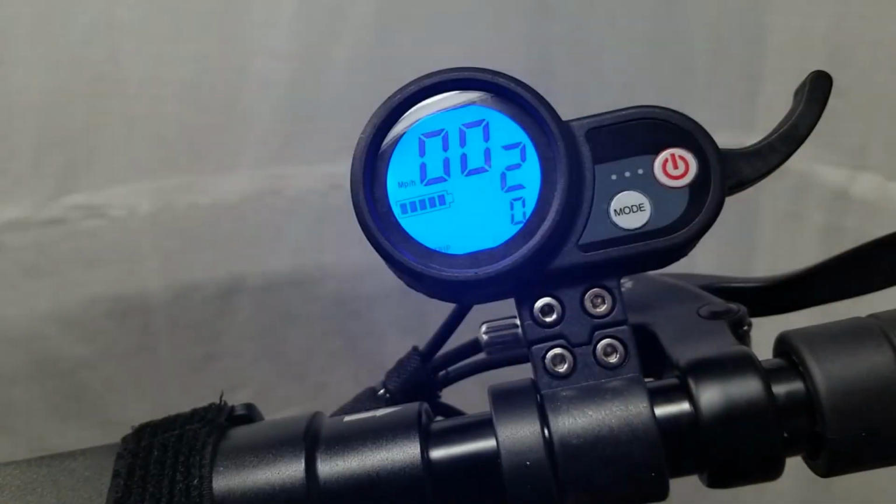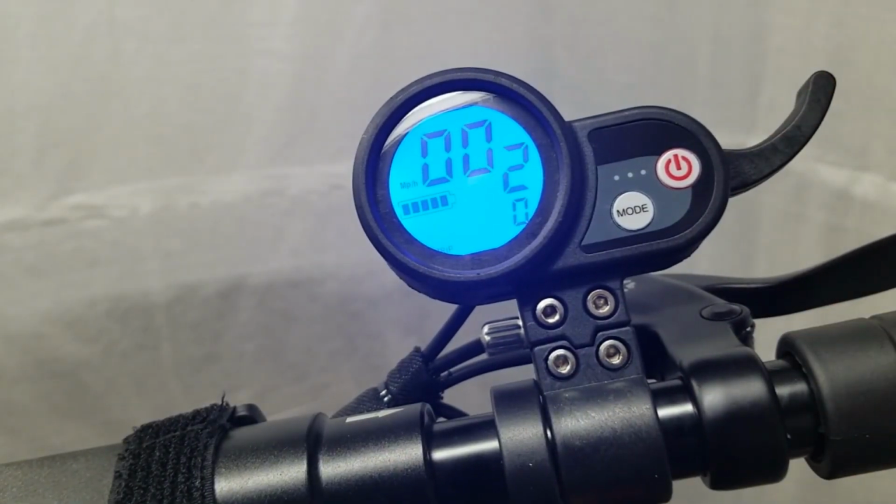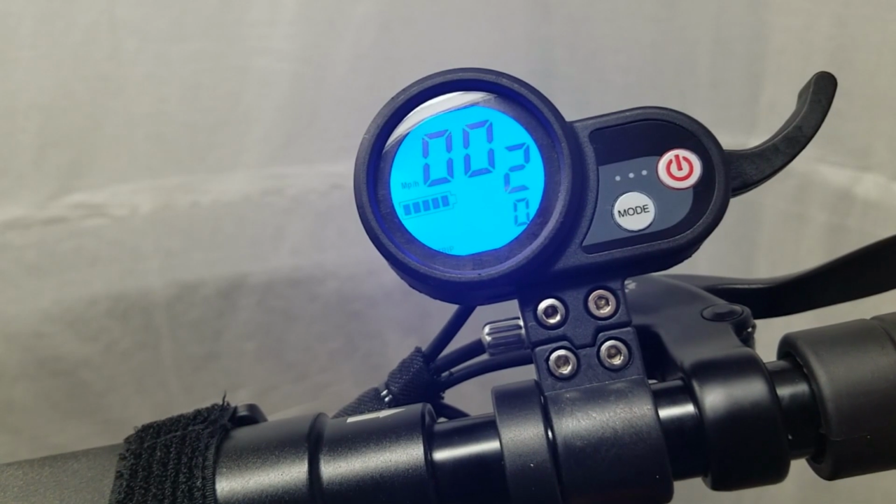Now, a speed sensor typically, at least on e-bikes and even the off-the-shelf speedometers you can buy at Walmart or whatever the case may be, it's usually those little magnets that you attach to the spokes of your bike, and then you hook the sensor up to, let's say, the fork of the bike, and as the tire rotates, that magnet is going to go past that sensor, and that's how you're going to reach your speed, and you can adjust that accordingly to whatever your wheel diameter size and things like that.